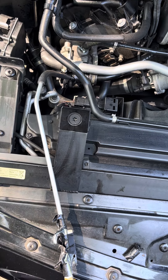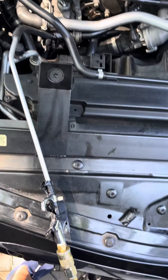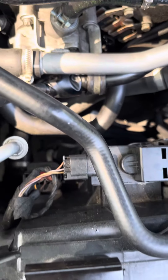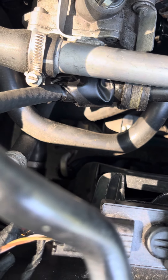So I just want to make this video on how I did a secondary check to make sure air is flowing from the pump, through the tubing, through the check valves, through the heads, out the exhaust. I just hooked up a compressor line, disconnected the hose that goes to the check valves, and shoved in a hose coming off of my air gun.